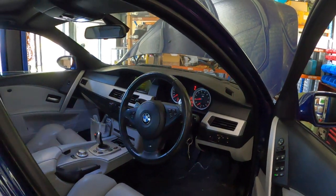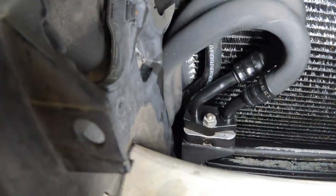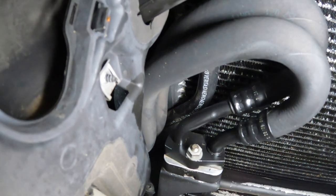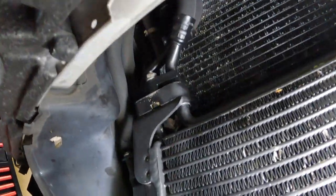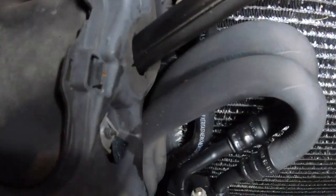From this point I'm gonna let it warm up. We've not let this car get to temperature in a long time, so just gonna let it cycle through and get some heat in it. It's gonna do some relearning. Just to show you the oil cooler fitting — it looks like that hose on the left, there is oil building up in the groove. Underneath is still dry; the O-rings aren't leaking, they look good still. But I'm seeing oil at the top. So I'll wipe that off and we'll check it again in a few minutes. The car's been running for about five minutes now.